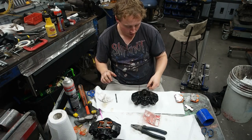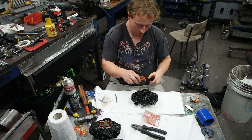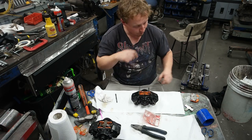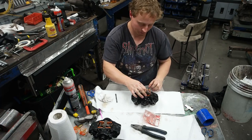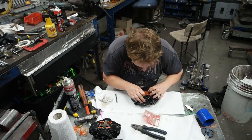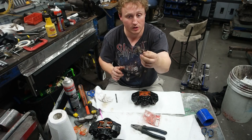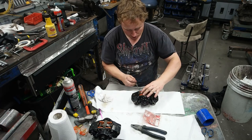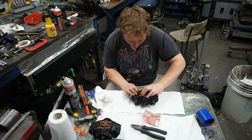Start with one pin. Put it a bit of the way through. Grab a pad. And start it off. Grab the other pad. Make sure you put it in the right way. Drive the pin home. Then, there's this other stainless steel piece. Sit that into place. Standard brake pad change procedure. Slide the other pin in. Push that piece down. Through it goes.